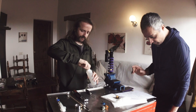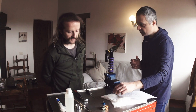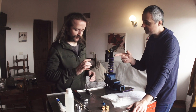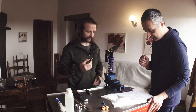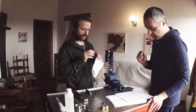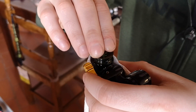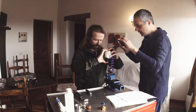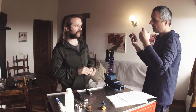So, insert the desired CTS, which can be orange — this one gives the lightest compression tune. The gold — the one that we removed. The green is probably the one that Joe would use. British racing green. So, insert the desired CTS by pushing it inside the shock body. Push until the O-ring of the piston goes into position. Use a paper towel because a little bit of oil may drop. Now you can put the CTS in — there's a click. You have to feel the O-ring in position. Positive click. Maybe with more oil in it the sound is less pronounced.